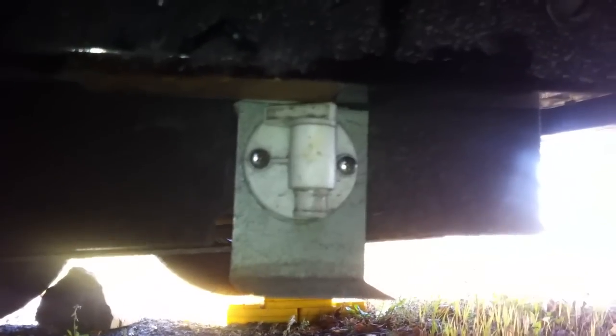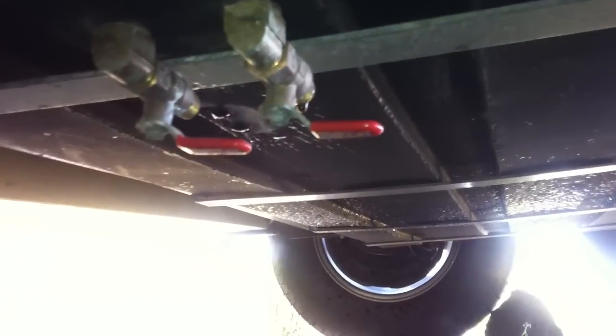Two tires on the driver's side here — you see there's a little valve with a petcock right there, that's your main water drain. And then let's turn a little bit to the left — there we go. Up under there are two other little valves; those are the low points for your water lines. You open those up on your last trip and let everything drain out. By the time you get home, there won't be any water left in your system.